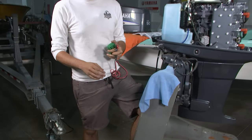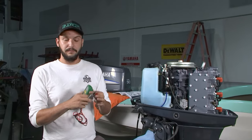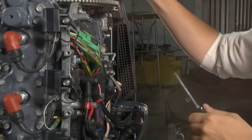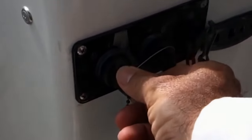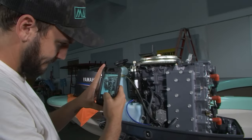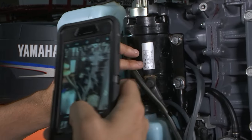I've got the battery cables disconnected and the wire going to the starter disconnected. A couple of tips for troubleshooting: a lot of guys will have an issue where their boat's been sitting and it won't start. A simple multimeter can go a long way — first check proper battery voltage, you want 12.5 volts. Then follow the battery cable to the starter relay and check you have that same voltage there. Have somebody turn the key and check voltage coming out of the relay — it should have the same voltage as the battery. If all that checks out and you're still not getting proper voltage at the starter, that's what needs to be replaced. One personal tip: take pictures on your phone as you go so you can see where everything is routed and hooked up.